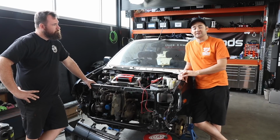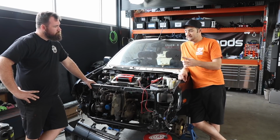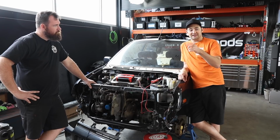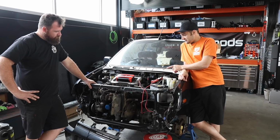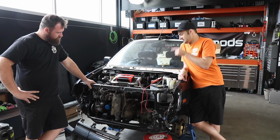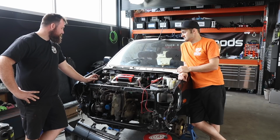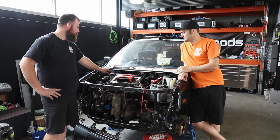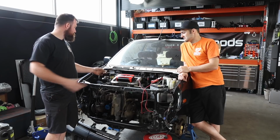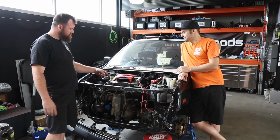So last time we saw the Mira, it was cranking. It was running just on some Aerostart, which is like petrol in a can that you're spraying to make it work. Smells mad. But what we think is we're not getting fuel. And Benny, why do you think that is? Well, we're getting fuel to the manifold, but I think probably the injectors are gummed up from sitting around. So we've checked, we've got fuel pressure at the filter. Yep. And then there's only a piece of hose 300 mil long from the filter to the manifold. So it's pretty safe to say there's fuel all the way there.